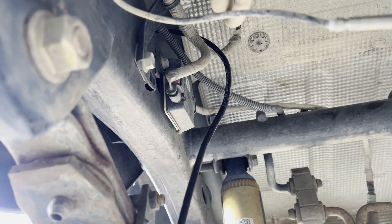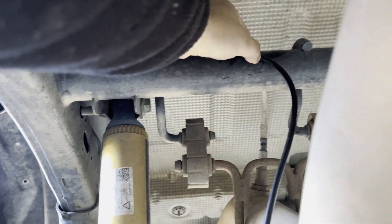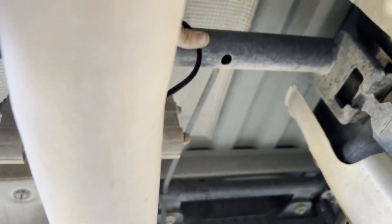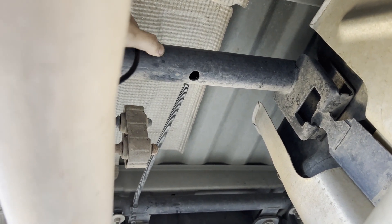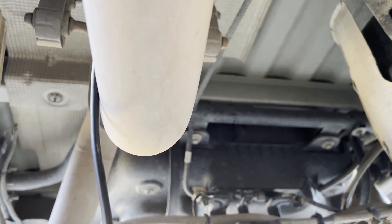So that's the wire from the passenger side — I brought it up the chassis from the fender all the way here. I'm gonna run it on top of the chassis right here and probably bring it back and zip tie it to this tube, which is really far away from the exhaust. Then I'll probably run it through the top of the diesel tank to the other side, or close to the hitch wiring back there. The deal is to run it as far from the heat as possible.